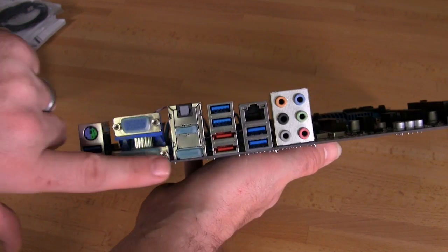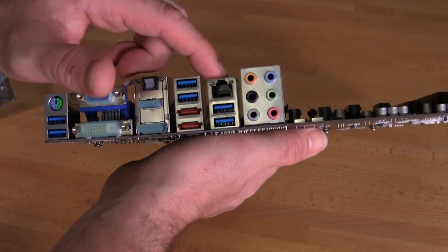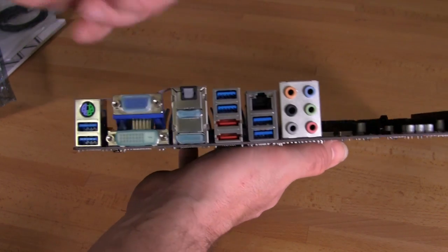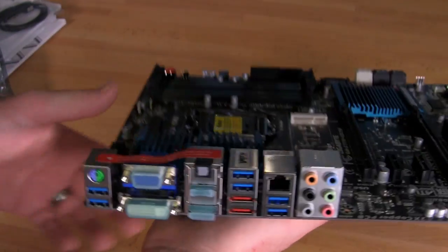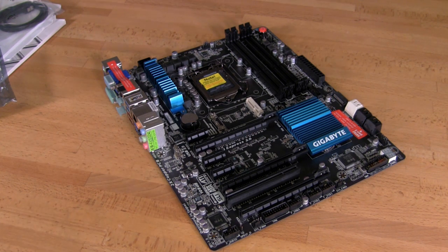Flipping back, you see you do have DVI, VGA, DisplayPort, and HDMI. You also have a couple of powered eSATA ports, a standard Realtek LAN port, your typical audio out, digital optical out, and the PS2 combination keyboard and mouse connector. So that pretty much covers all the features on the Gigabyte Z77X-UD3H motherboard. We're now going to throw it up on our bench, drop in our Core i7-3770K, and see what kind of performance we can get out of it. We're also going to try to reclaim our 55mm 32GB SSD that uses the mSATA port and test some of that functionality with one of our older magnetic platter HDDs. If you like this video, click the like button, be sure to share it, and subscribe to keep up to date with the news and reviews we have for you.